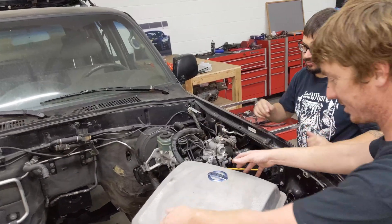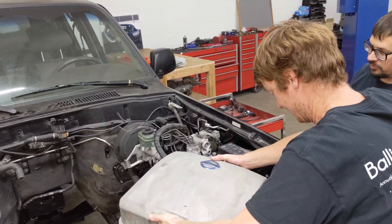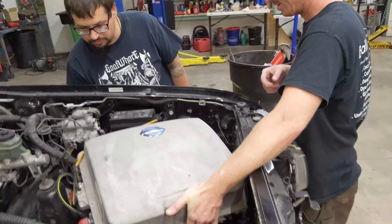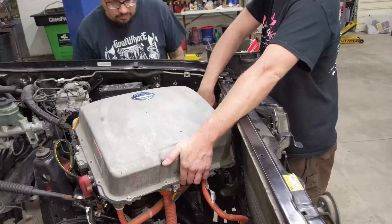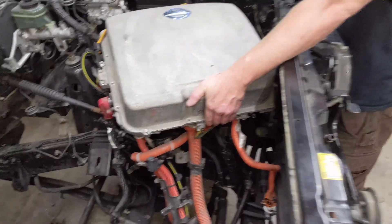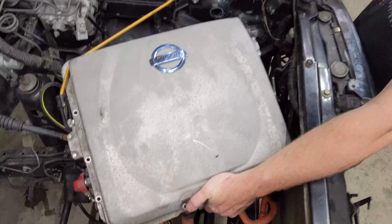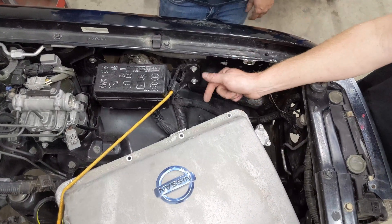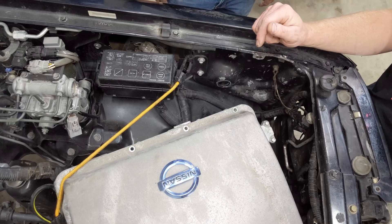So this is the charger. We need to put it level here, and then there's some brake lines and stuff underneath we don't want to smash. But there are some mounting points — you can see that bolt there, there's one there, one there, so they're all around. I'm thinking we'd use a little piece of strap steel, then bend it and weld it to the frame and the body.